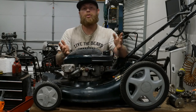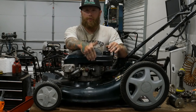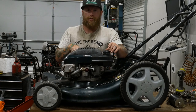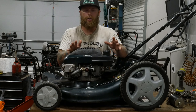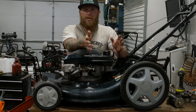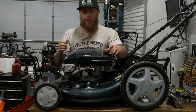A lot of people ask, and some people just don't know, and that's fine. That's why we're here — to tell you always tip away from the carburetor. No matter what, even if the exhaust is on the other side and you're afraid of it filling up with oil, tip away from your carburetor. It'll make your life a lot easier, and it's totally okay to have it tipped for several minutes. The oil will drain back down into the case and lubricate properly.